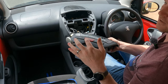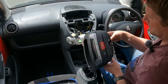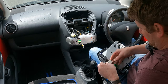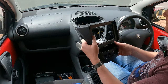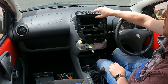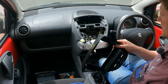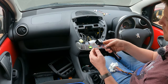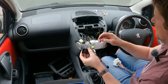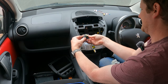So that's the stereo out. We need to transfer the buttons from this bit of plastic trim over to the new one. To do that you've got a little push tab on the back, just holding those in place. This ultimately just clips into place over where the original one was. However, we can't put it in yet because the screen screws onto the back. So the first thing we're going to do is get the screen fitted in here — this is the power block that goes on. You've got two different positions on the pin so you can't mess it up; they'll only go in one way. So those two are in.